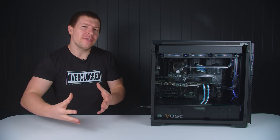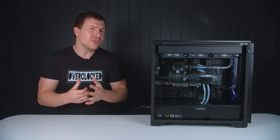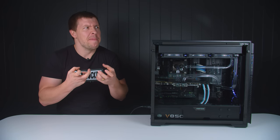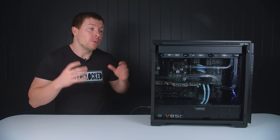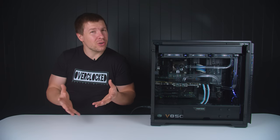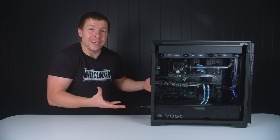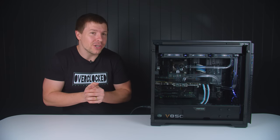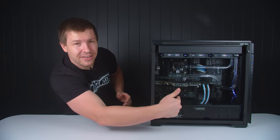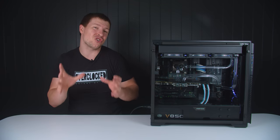We decided to upgrade the tubes to 16 millimeter tubes because with 12 millimeter, the walls just aren't thick enough. And over time, all of those tubes decide to melt in some way and deform, which is not good for the loop. I tried to keep the loop similar to the original loop because that's what the client bought this PC for. That's why he loved it. But we fixed up all of the wonky tubes. The only difference is this tube, instead of going down and under the GPU, it is up and above so that it's an easier drain port facing straight down.